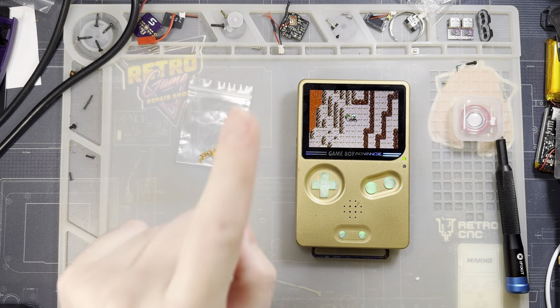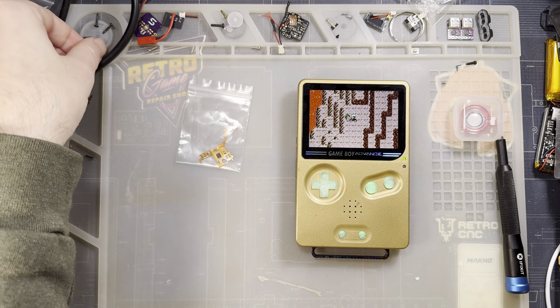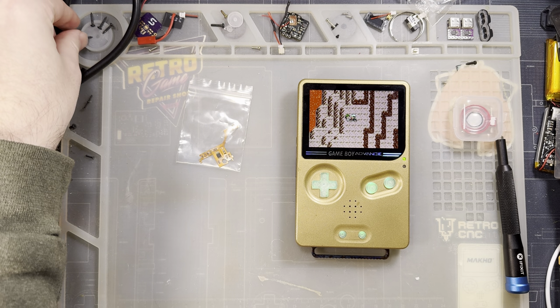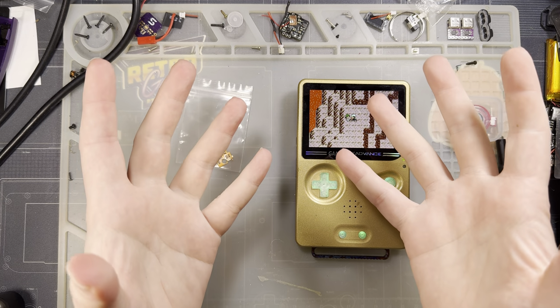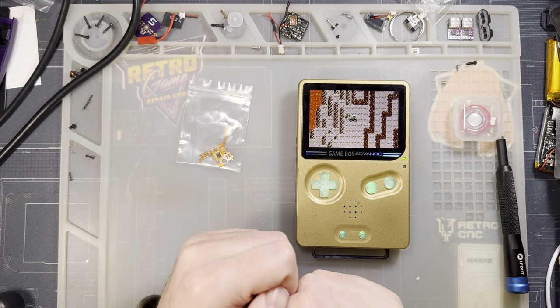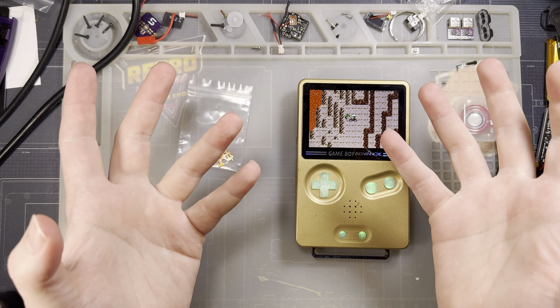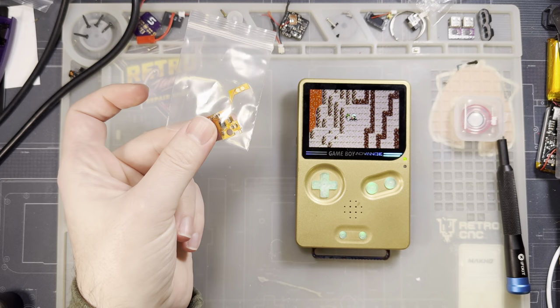In fact, if you've installed one of those power cleaners and you notice your Game Boy is starting to act a little funny, maybe look a little bit more closely at that power cleaner. Such as you turn it on and then it blinks off and you have to turn it back off and on again, that's your power cleaner. You turn it on and the fuse pops, that's your power cleaner. I don't recommend them. But anyway, amp.